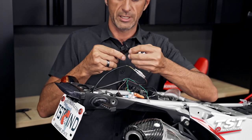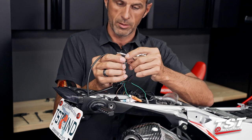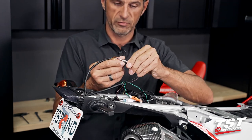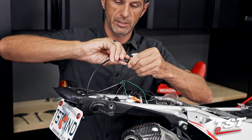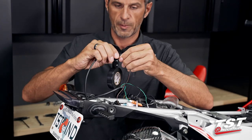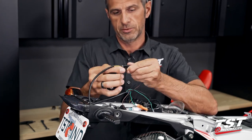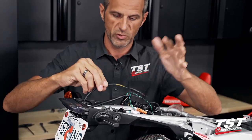I like to make sure that I start with the positive wire, so not black. This is the more important one to keep insulated. Get that guy situated first. Confirm that it is completely isolated, insulated, and nothing sliding around. Get the other side locked, and then a final pass of tightly wound electrical tape will do. We'll finalize this for us. Nice and neat, ready to go.